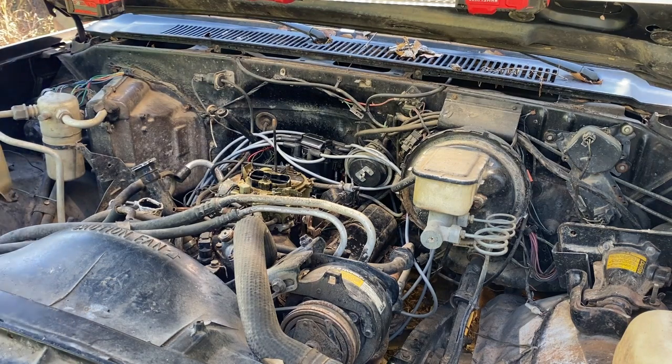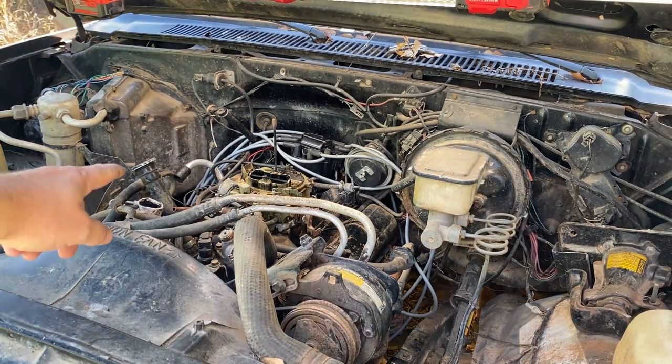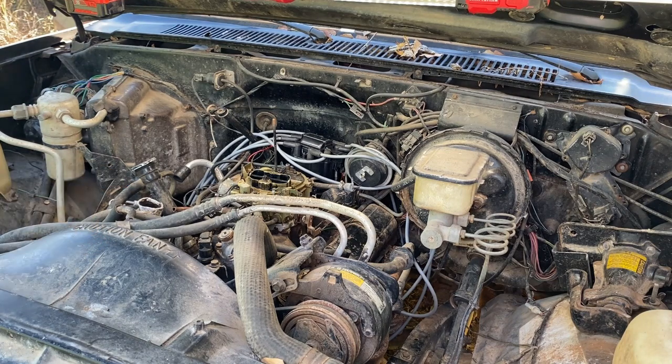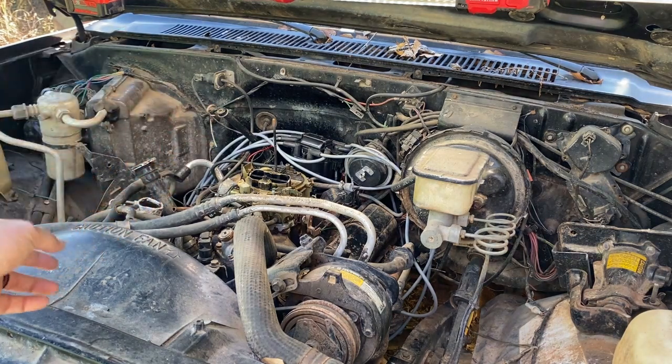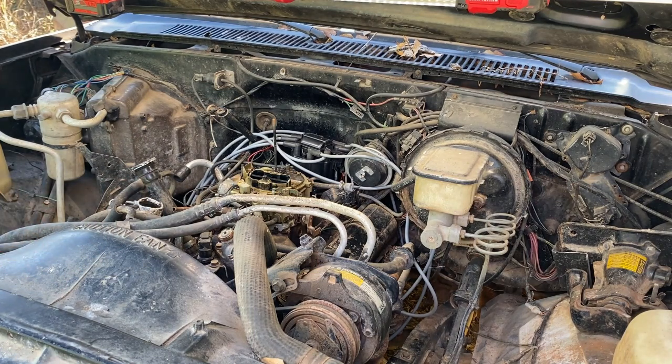Man, that's awesome. I don't know if that's leaking from the accelerator pump or if that's just a little puddle of gas I missed. I think I may pressurize this tubing down here and see how bad it's gonna leak. I think it's gonna leak no matter what, but we'll see how bad, and then maybe we can see if fuel's getting through there, because I did check last night, there's no filter in there. So whatever junk got pumped up, which my bad, I can't believe I didn't undo the fuel pump, whatever junk got shot through there, there was no filter to catch it. So I'm hoping we can even move gas through there. So let me try that and I'll get back to y'all.